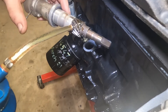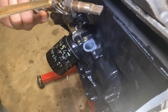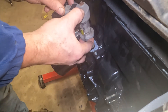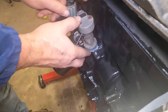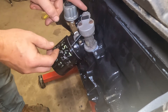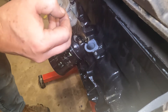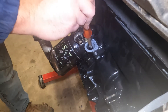I'm making sure there's a good amount of oil on the gears. I'm positioning the sensor at roughly the seven o'clock position — not straight down, but about seven o'clock — and as I slide it in, it should engage the teeth and rotate. Right now it's not sitting properly at the bottom, and if I force it all the way down it's not pointing backwards. I need to start again in a slightly different orientation and rotate the oil pump drive at the bottom again.